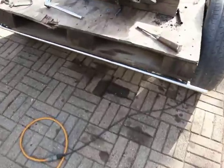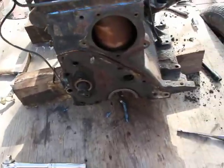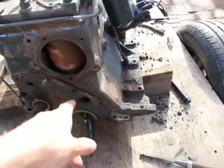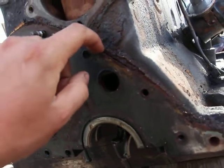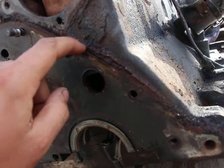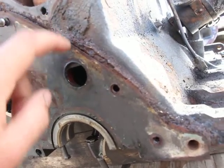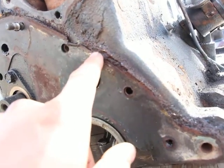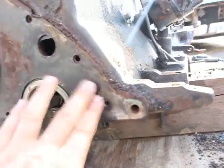The Thunderbird's back and here's the engine — a lot of junk and garbage on it. There's a leak here as you can see; this gasket is bad. When you pull up the gasket and it's flimsy like that and it's got space on it, that means it's bad in that section. And you can see where it used to leak here — this part is nice and firm and straight.